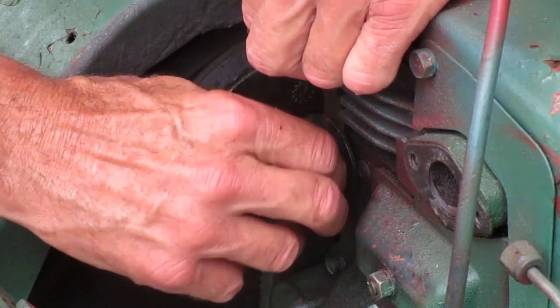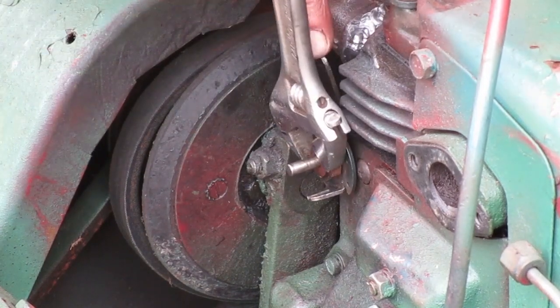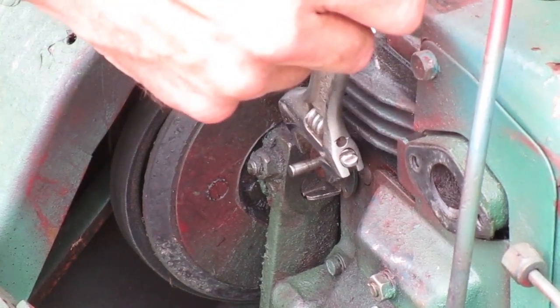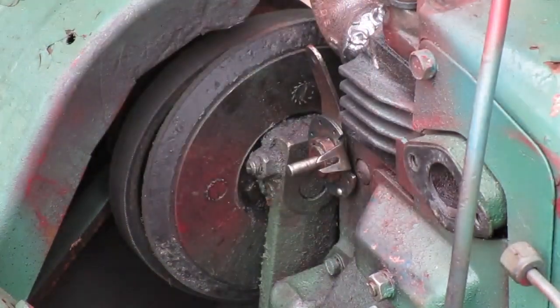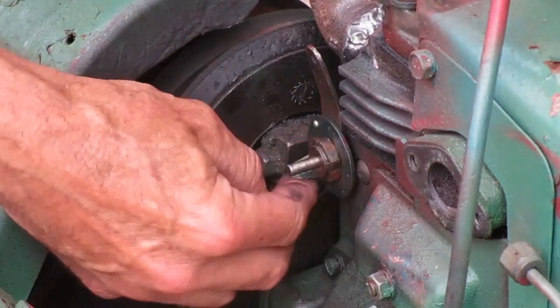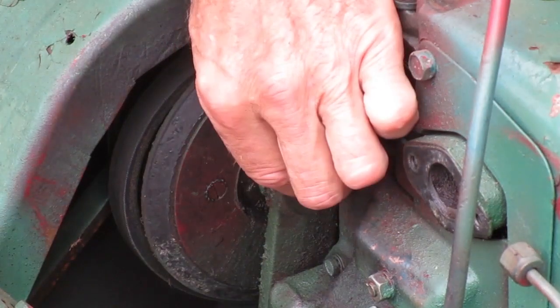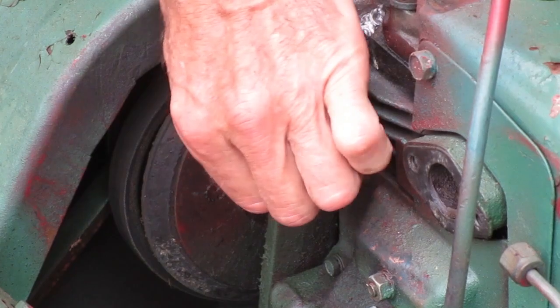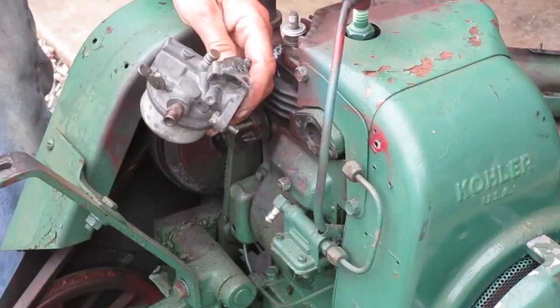That should work. There's a bend in that part to help line up the cable with the movable disc, but the bend is above that disc. It has to be flat behind the disc. That's good there. I'm blocking the camera here, but also make sure the shaft is free to move. It should go in and out a little bit and be able to rotate easily.